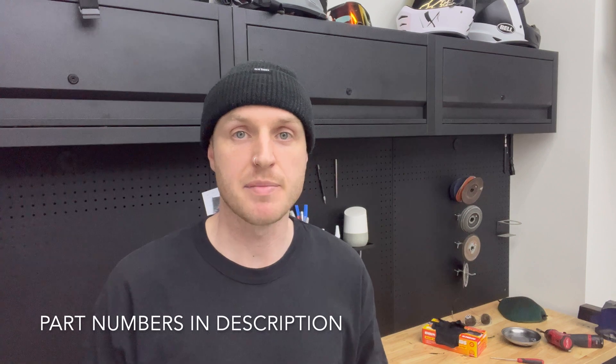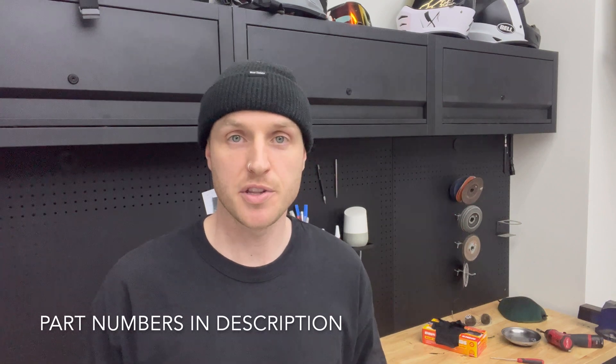This can cause a loss of oil pressure, and when you lose oil pressure your motor's done. Fortunately, KTM realized their mistake and in the last year of this generation they changed the part number for these gears to a new part number — and that part is now metal. I've ordered those new gears and in this video I'm going to take you through the process of changing out the plastic oil pump gears for the new metal gears.